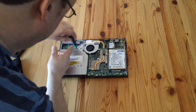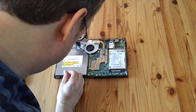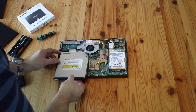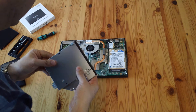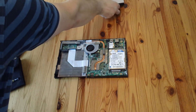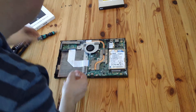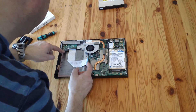We have to keep the whole thing apart to get it out, so I'm going to take the CD drive out so I can get at the cables. There aren't any shortcuts unfortunately. Release those two screws and the CD drive just comes out - it's a laptop-style one so it seems a little flimsy. I'm going to flick up the little connector and take the ribbon cable off the little circuit board that links into the CD player.